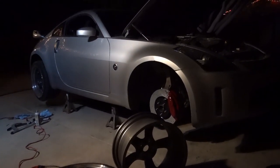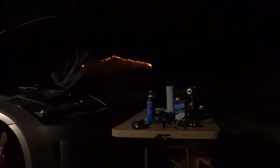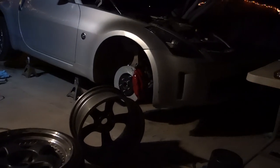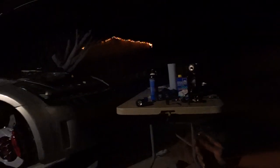But I guess we'll have to either continue to another day or end this video here. I don't know what we'll do first because I don't know when it's going to get fixed. Hopefully next week. Yeah, order everything today. Hopefully I'll come next week and get it rolling. Maybe I can find a spare set of front wheels from someone. Or maybe you can find some spacers on OfferUp right now. That's true, some hub-centric spacers. Oh, but you still need the studs. True, unless I can find them locally. Yeah, that'd be a lot quicker. If not, we'll have to wait.